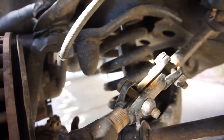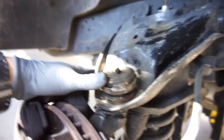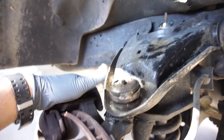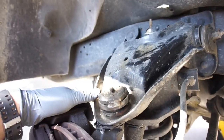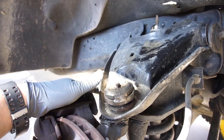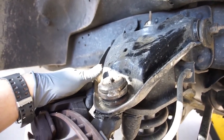I don't know what's going on with these things. It's all coming from the leveling kit we put in - a 2-inch leveling kit on the truck. I'm pretty sure that's what it's coming from. So I think we're gonna heim-join it, or make some control arms ourselves. Probably just make up a jig with one of the other ones. You'd have to do a left and a right, so I'll have to make up some jigs.